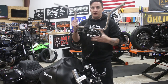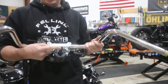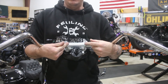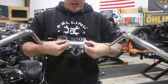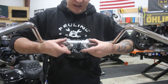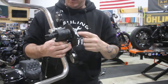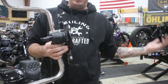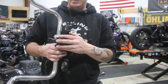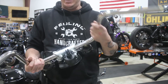You can see why it's so clear that your ignition switch is going to have to go. If you think about the riser mounting points here, with the Krauss T-Rex pullback plate, it's going to pull everything back so that the bars will clear the fairing, but it's going to put your bars and that plate right where this ignition switch is. So the ignition switch will get unscrewed from the triple tree — we'll save it for the customer in case he wants to use it for something down the road. We'll get that out of the way, bolt everything back together minus the ignition switch, and get this back on the bike.